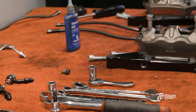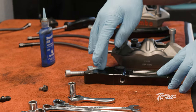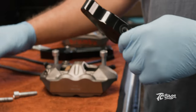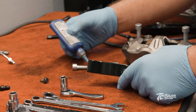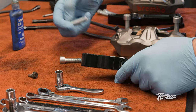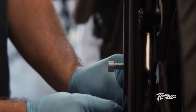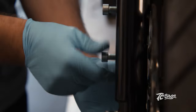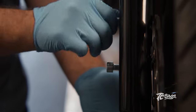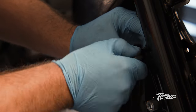First we're going to start with our radial brackets. These do come in raw and black. We went with the black brackets just to match with the front end — we got the black legs, black wheels. We're going to start with some blue Loctite on our mounting bolts. We'll go ahead and get these mounted up finger tight and then get our calipers mounted up and make sure everything's aligned correctly before we start torquing the bolts.